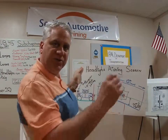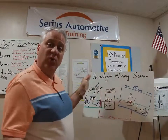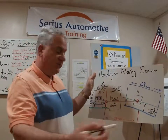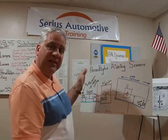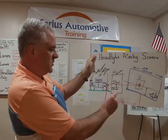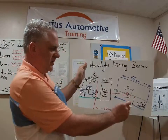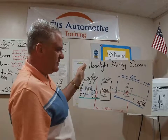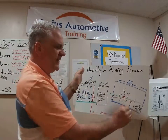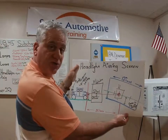If it's out of that area, it fails. It's primitive but it still works — it's what they still use for motorcycles and vehicles. If your shop is using this, you've got to be 43 feet long, with the screen 25 feet in front of the headlight. Turn the lights off, set it up, turn the lights on, and make your measurements. It's a lot of measuring tape work, but once you do one, no problem.